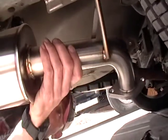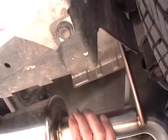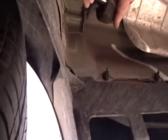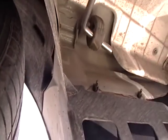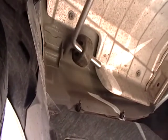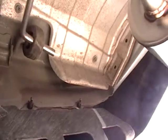All right guys, there's an upper hanger and a lower hanger. It's easiest to get it in the upper hanger first. So we're gonna go ahead and squeeze it up in there. Now, if the vehicle's fairly new like this one was, you may not really need to use any brake free on those exhaust bolts themselves. Although I can tell you, as time goes by, they get a little stiff, so feel free to use some brake free. I wouldn't use a lot of lubricants on these exhaust hangers, because that can cause them to get brittle over time and dry them out.